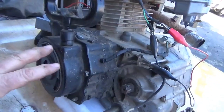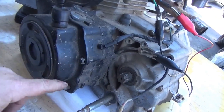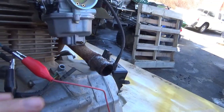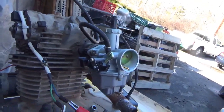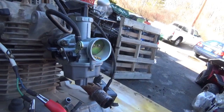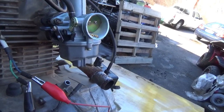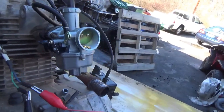The last thing you want to do is reach your hand over and discover that thing spinning — it's kind of hard on the fingers. The other reason to put the cover on is that sometimes they leak oil if the bolts aren't all the way in. You'll also notice my hand was over here away from the exhaust, which started to get hot — that's why you saw it move. Normally after the first few beats it'll be running kind of slow, but then the RPM will start creeping up, as you noticed. I was going to try to turn down the idle but I wasn't successful at that.